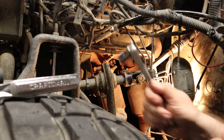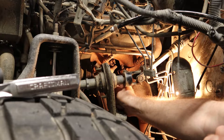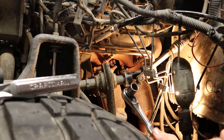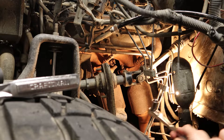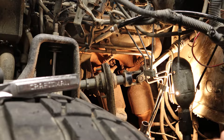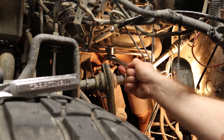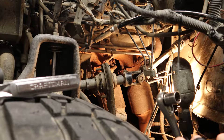I don't have a lot of room, especially on this front one here - there's not a lot of room to swing because there's this guard here that looks like a heat shield of some sort that's in the way. You could remove the steering linkage here, that might give you some more room. These hard lines for the brakes could probably be bent out of the way but I don't really want to mess with that if I don't have to. And these guys here which appear to be part of the fuel system - one of them goes to this vent here. You could probably disconnect these brackets and get them moved out of the way too, but I'm going to try to not disturb that stuff, mainly because I've already disturbed enough.